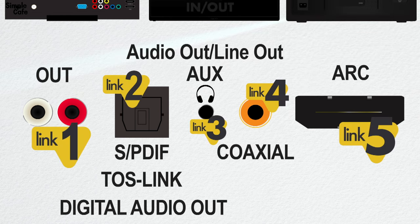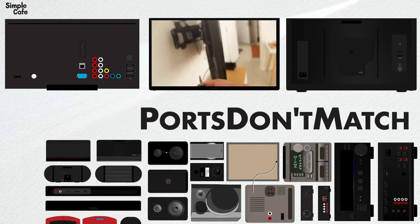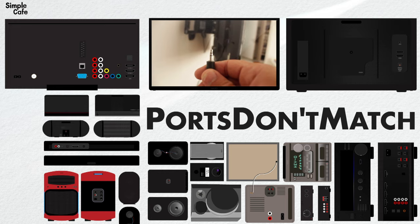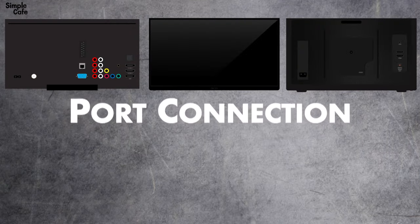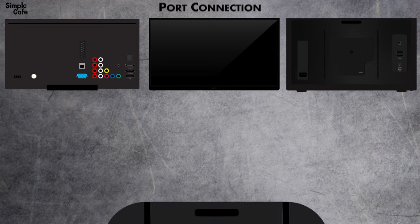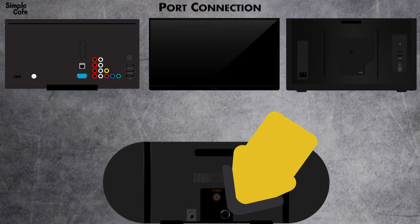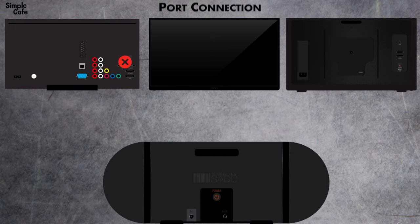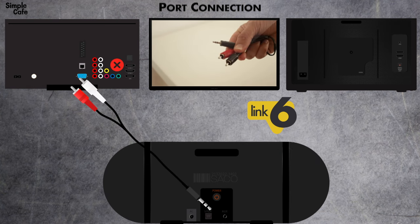Here are links in the description in case you need cables. Connect your TV to your sound system whenever you're ready. But what do we do if the ports don't match up? That brings us to our last fundamental: port connections. If you're lucky, the ports on your sound system and TV match up, but if they don't, not all is lost. Let's say your speaker only has an aux input but your TV doesn't have that same port - easily enough, you just bring in an aux-to-RCA cable. Find it in the description - it can be flipped however you need it.